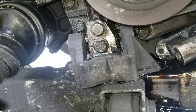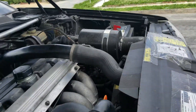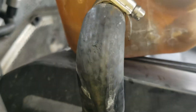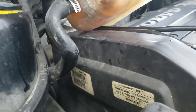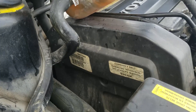Now I need to get this mount here replaced — it's trash. So let me check with him and see if he wants me to check this rear cam seal on the intake cam to see if that's leaking. And if that's it, we just need to burp this coolant system and check if the heater core is leaking. Bottom of this bottle is a little damp, and the bottom of this hose is a little damp — coolant leak could be there. But let's check the heater core just to make sure. That looks a little saturated — I don't know how much coolant they're losing, but they're losing some.